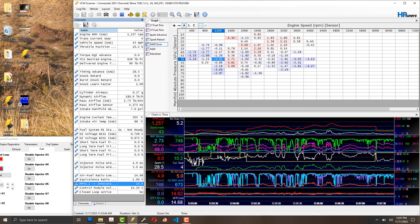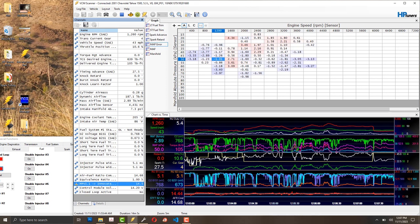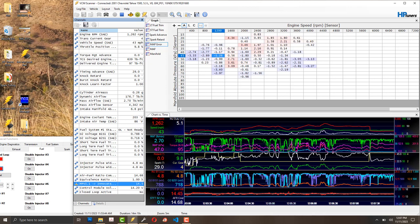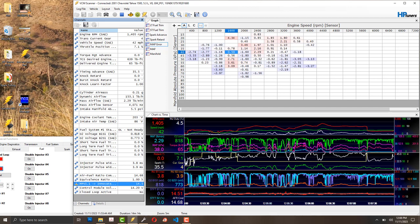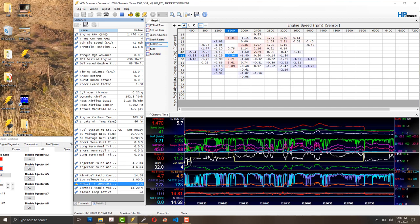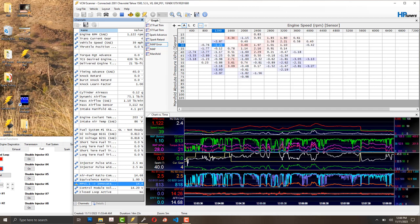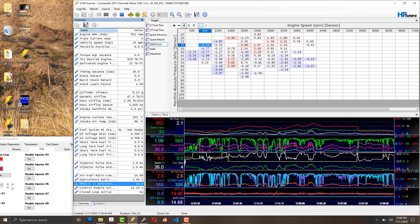On the VE table you can bake in higher or lower air-fuel ratios. If I'm at 90 kPa or higher and 4000 RPM or higher and the narrow bands aren't being used, you could just bake a 12:1 AFR in there and not rely on power enrichment. I think that's how the factory tunes the trucks — they don't have power enrichment turned on until 90 percent throttle.